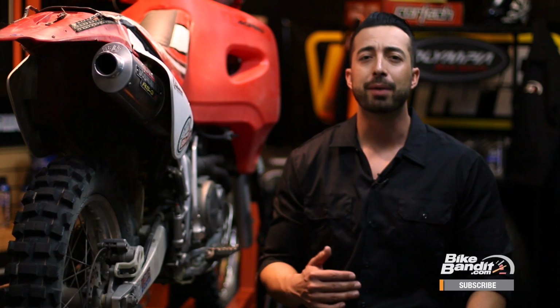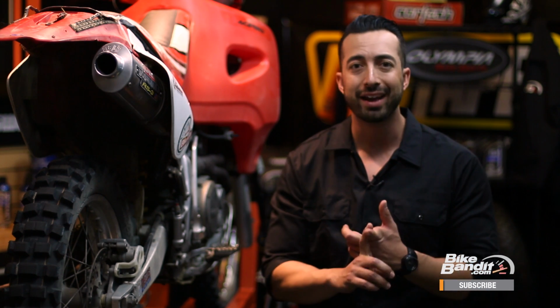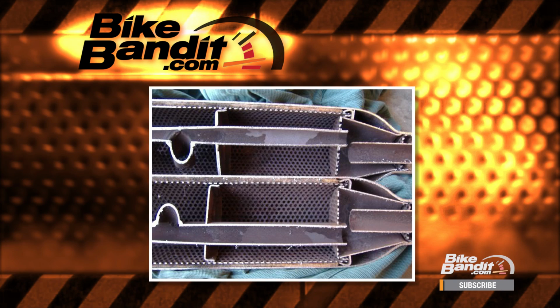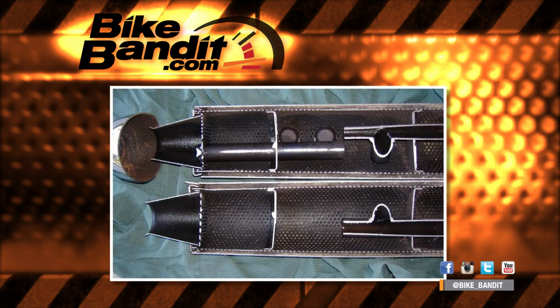First off, let's talk a little about the difference between OEM and aftermarket exhaust. When it comes to OEM exhaust, manufacturers have their own priorities. They want them to be quiet and to last for years without maintenance. So they're made with thicker walls, using a series of baffles to redirect and muffle the sound, and they build their systems out of things like steel and aluminum, which require no maintenance. This makes them quiet and durable, but also heavy, and they also restrict performance.